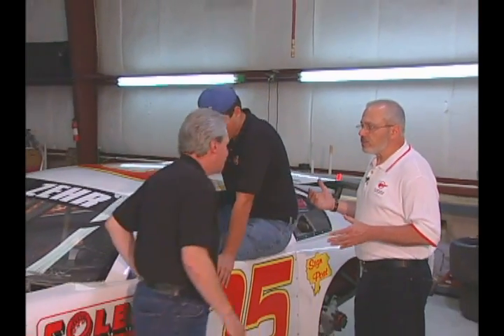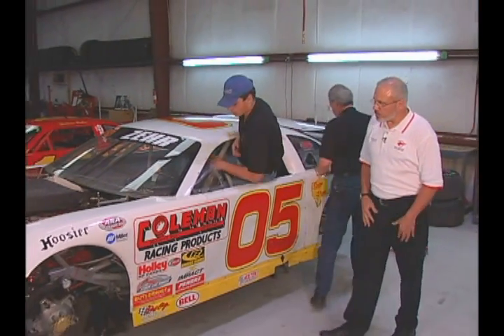So during the course of the evening you actually made two adjustments putting more front brake in the car from that even pressure setup that we started out with as our baseline setup. Yes, I did. Well, let's use our gauges and take a look and see just how much adjustment you've made. Roger, do you mind stepping to the back and seeing what's going on on that rear gauge while we look at the front?